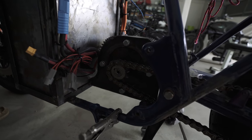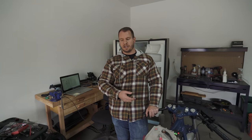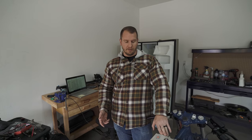It stops. So there's no grinding. What's happening is it's trying to regen when there's no movement, so the controller is sensing movement when it shouldn't be. There's an issue with the controller. What we've determined is this is probably a bad unit and we're gonna get a replacement. She said that she would send one out as a replacement.